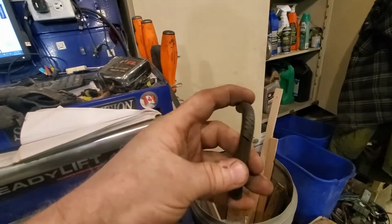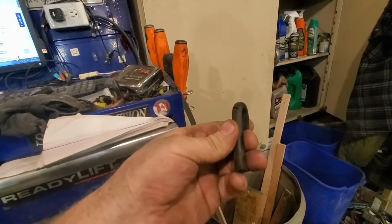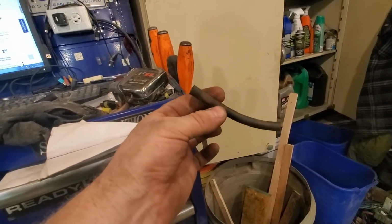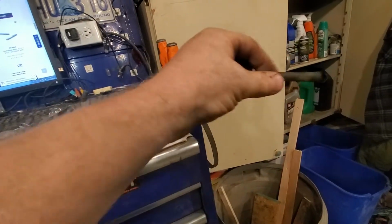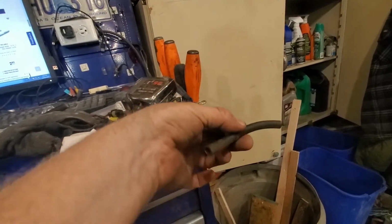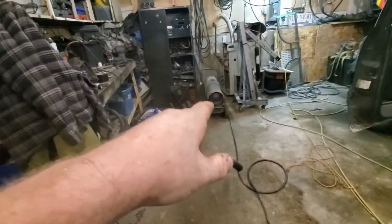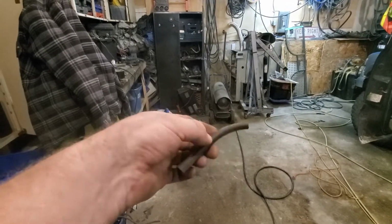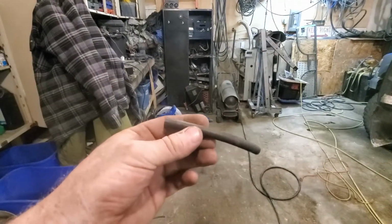Yeah, so that's just no good. So now what I've done is this was a whole lot longer. It was about 6 times longer than this. So I've cut out the good spots where it went from the pump, because it goes from the pump, like that, goes down into a hole, goes over, goes back up underneath, and then goes to the business end, and it draws fuel, Venturi effect, through the nozzle, then pushes it in.